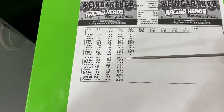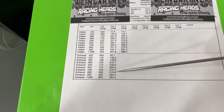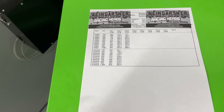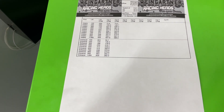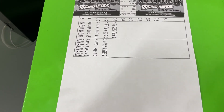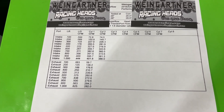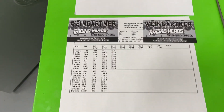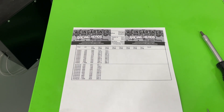On the exhaust, 282-284 is where it peaked on the Super Flow — it didn't make a dramatic jump. Still considerably better than stock because of that ridge. You can go back and watch the video on how much difference an as-cast port flows — this was the head I used for that test. The intake flowed 356 stock, so it's gained about 40 CFM on both. That's a really good pickup — this thing is going to make some big power.